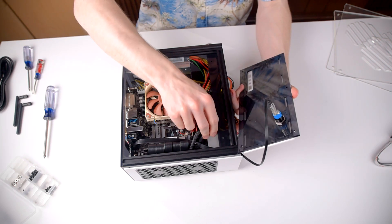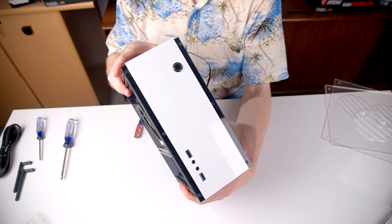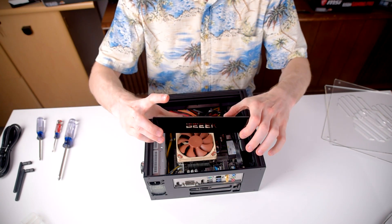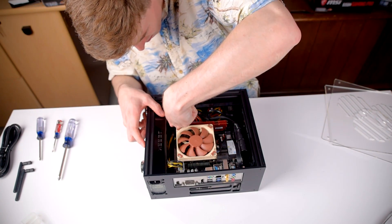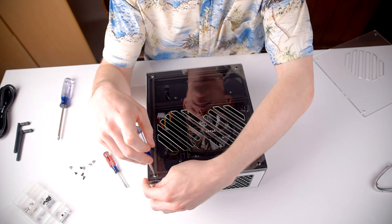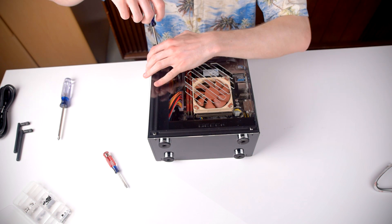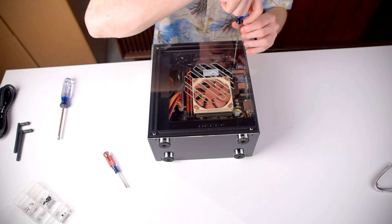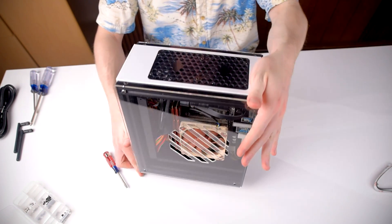With that all taken care of, now you can install the front panel — it's just a matter of lining up the openings for the front IO and screwing it in place with the 6 mounting holes. The last step inside the case is to put in the power supply shroud which slides in on top of the power supply and fits close enough to the case that it'll stay in place by itself. Finally, the last part of the build process is installing the side panels. These are much easier to put in because you can clearly see how the nuts are aligned in the aluminum bars. Make sure you line up the vent holes in the panels with where your CPU and GPU fans actually are for proper airflow. Each panel is held in place with four screws and four nuts, and once they're in place, the build is complete.